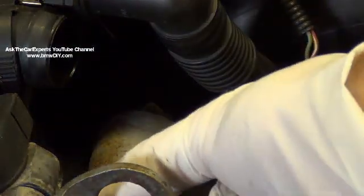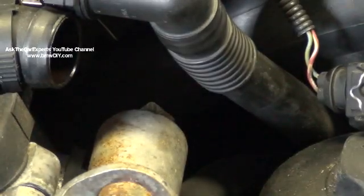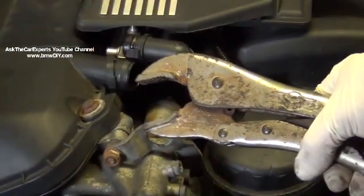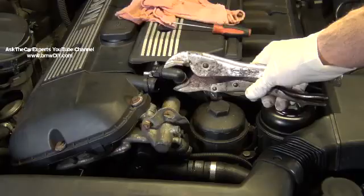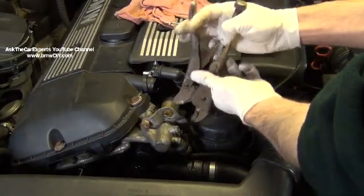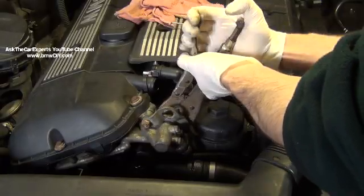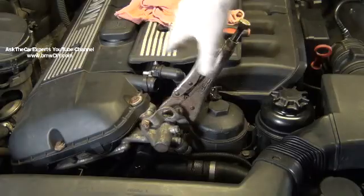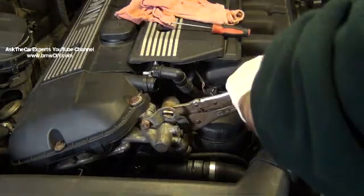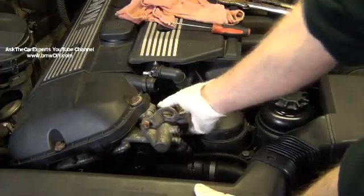It's hard a lot of times to get a wrench in here, so I like to just use a pair of vice grips. Flip them over and just get a good bite on it right where the solenoid is, and just give it a pop down. Usually it comes free. Once it's loose, they unscrew pretty easily in most cases.